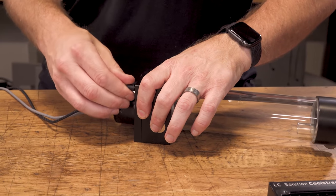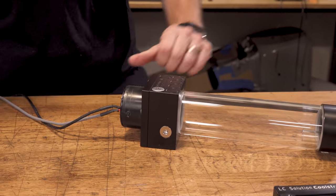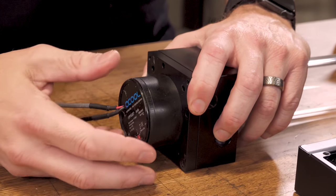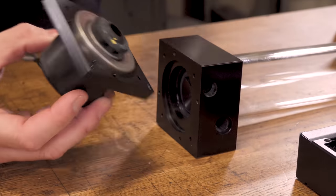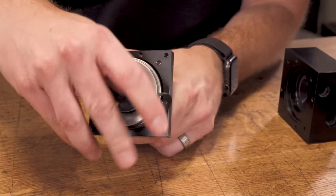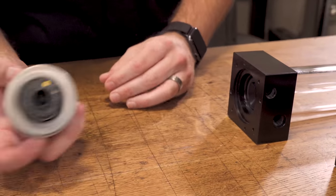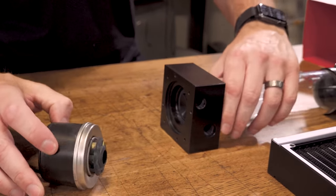I don't want to potentially deal with that again. This pump has been sitting dry forever, so I'm going to be removing it and putting on a different pump. It's a lot of screws to get to it. Just like a regular D5 standard housing, it's held on with a collar — this one just happens to be square, as you can see. And then there's an O-ring right here that seals it. So we'll take that off because we want to clean that, and then this just comes off. It's just this collar and that O-ring that holds this into there.